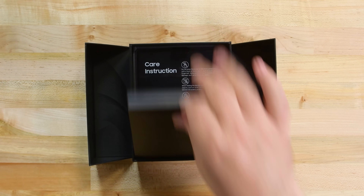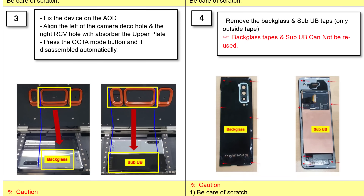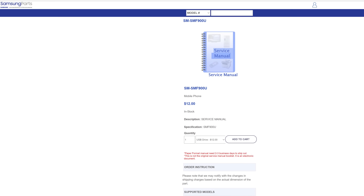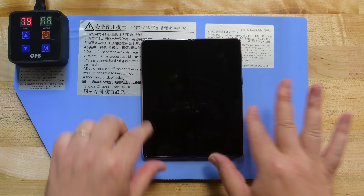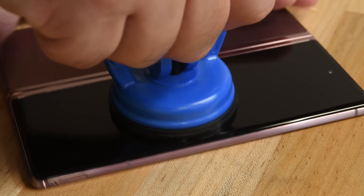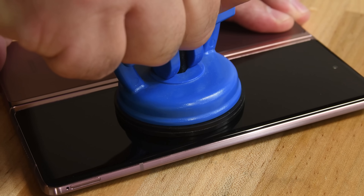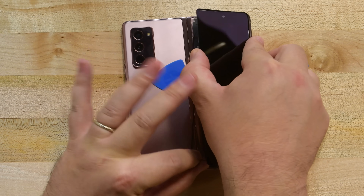For this new polished phone, we try a new polished opening procedure adapted from Samsung's own service manuals, which you can actually buy from Samsung if you know where to look. Since we don't have the little oven chamber that Samsung uses, we try 10 minutes of exacting temperature on a heating pad, at which point the glue softens up so much this 6.2-inch cover display almost lifts free with just a suction cup.